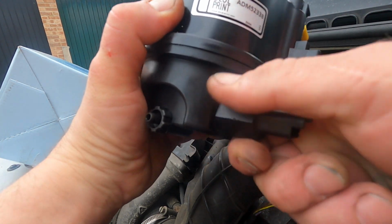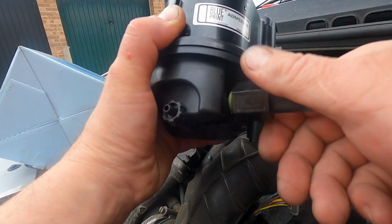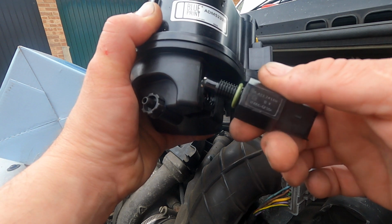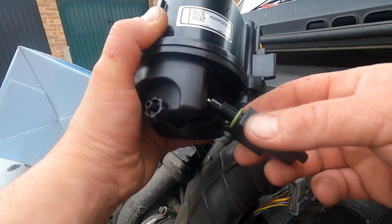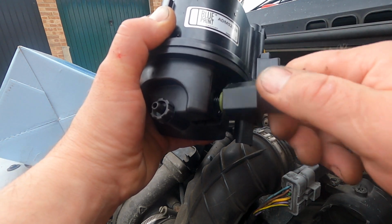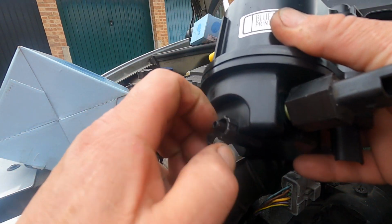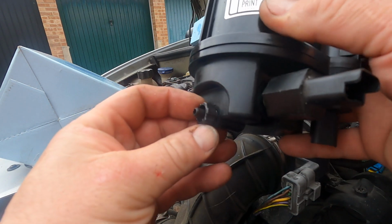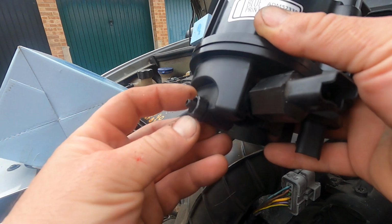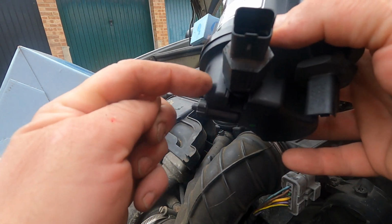Right, okay, so we have a diesel filter here, a fairly modern one. In the bottom of this, it has a water sensor, and basically it just reads the voltage. When it senses water, it will put a light on in the vehicle, and this is the way it goes because people don't ever take water out of the filters, but this is something you should be aware of. The light comes on, you need to take action. At the bottom here is actually a drain for water, and this should be done regularly, at least once a week, or depending on how many miles you're doing or how many litres of diesel you're putting through the system. But that's right at the bottom of the filter, which will drain out all of the water.